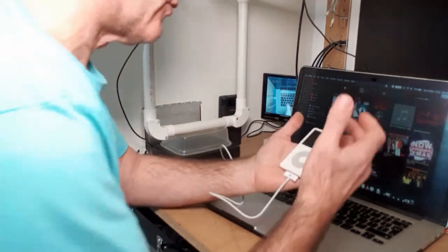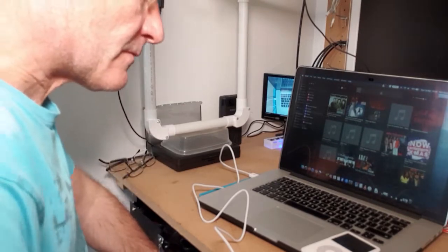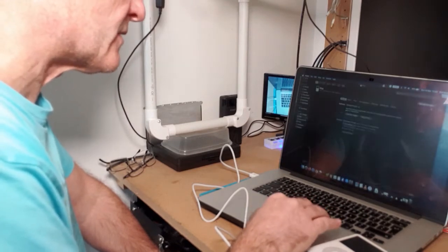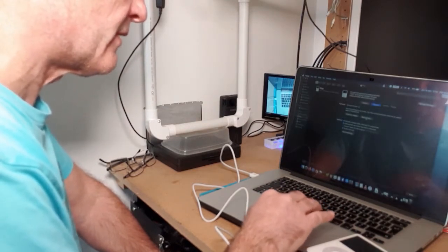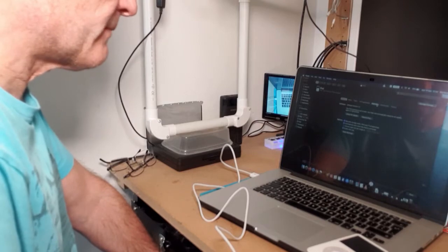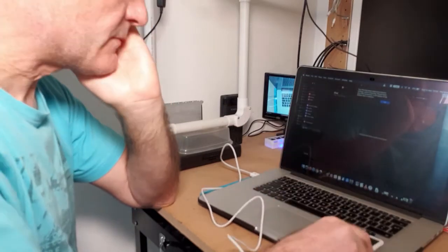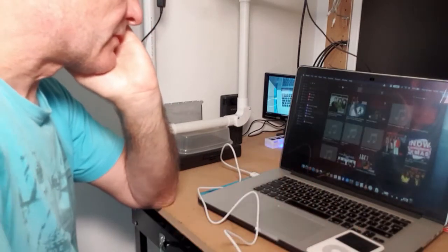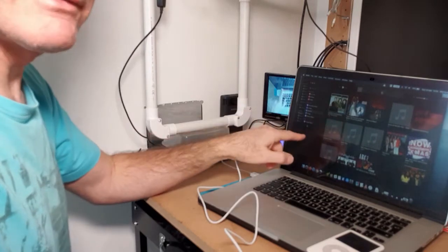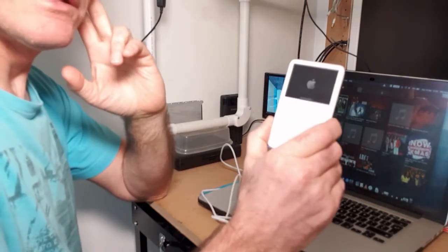Just so I can clear it all down and have a good starting position. So this should come up on the screen — there we go, we have the iPod. Let's look at the sync settings and restore the iPod. Restore — so hopefully it should go ahead and do the full restore. The iPod is now showing the little Apple symbol, rebooting. We'll wait until that reappears down here in the sidebar.